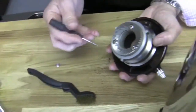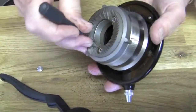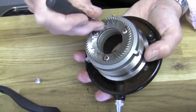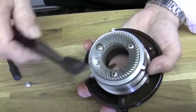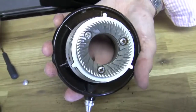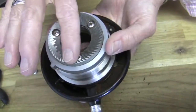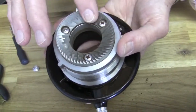If you want to get really fussy, you can take a pick and get in here and loosen all that junk. At a certain point, it isn't worth worrying about the little fine points so much as getting the big chunks out. We've had this grinder for a while — not a crazy amount of use, but a fair amount. When would I need to change my burrs? Well, you can see there is a little bit of wear. You run your hand backwards, and if they start to feel dull — which these are starting to feel — that's one sign.